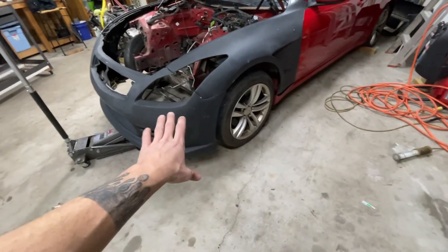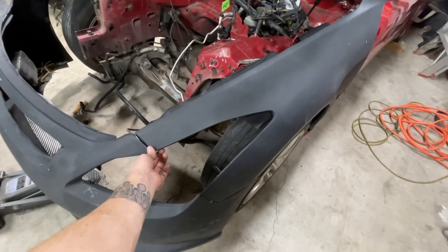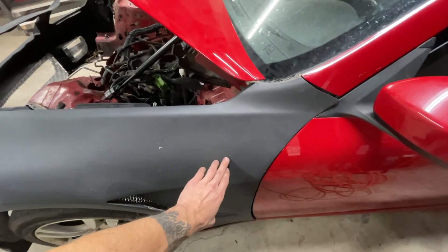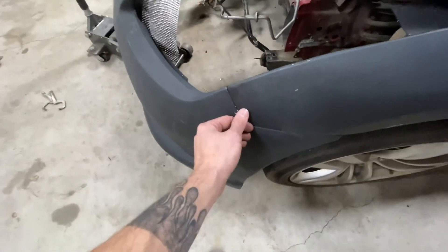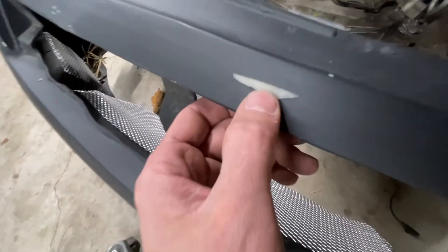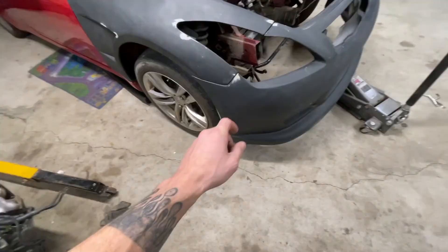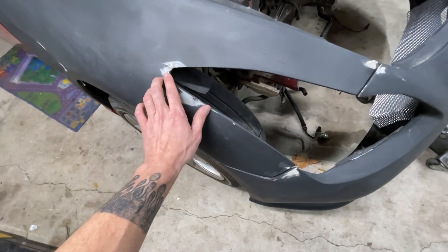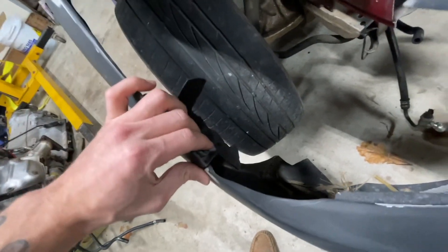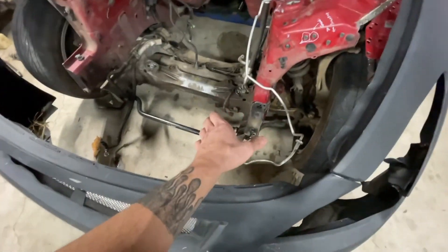So this is the kit and I already have it on the car, temporarily fastened together, trying to get it as close as I could. I believe this kit's pretty old because it doesn't really want to flex to where it's supposed to be. It's got some imperfections we're going to have to work out — it's got chips down here I'd sand out and fill in. All in all it fits pretty well to the body. I started sanding on it a little bit where these busted spots are; this is going to get filled in with some body filler, and there are some parts that are going to need repair on the back side.